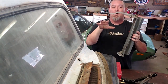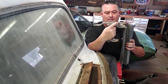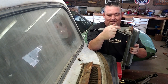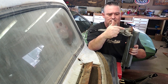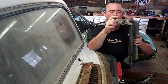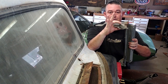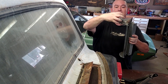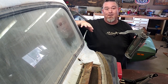On the inside of the truck, on the driver's side, there's a bolt that creates tension to hold it open and shut. You're gonna have to get under there — I believe it's seven-sixteenths is the size. You're gonna need two wrenches: one for the bottom, which has a captive nut, and one for the regular bolt head on top. You're gonna loosen both of these up. If you can actually take them out, that's even better, because that bolt being there makes it completely impossible to pull this thing out.